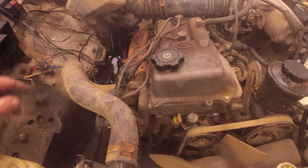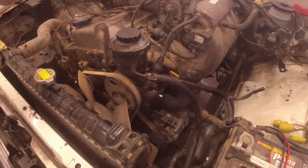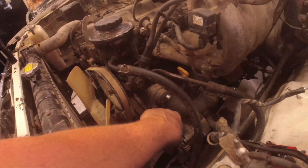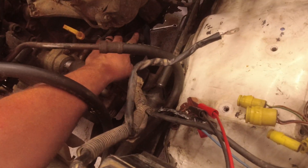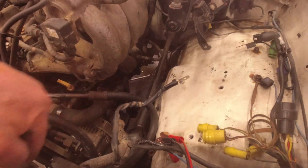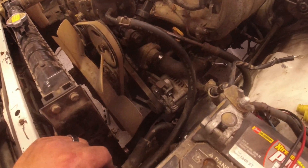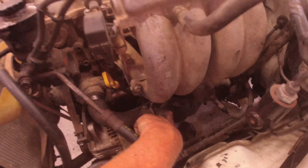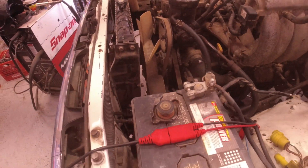This is the upper radiator hose out of the Tacoma and it just goes right where it's supposed to with no modification whatsoever. On the other side, the lower radiator hose is the one off the 22R - that's the elbow hose with the metal tube that goes around behind the alternator and comes out down there. All those hoses off the '85 or the 22R fit perfectly. I put a cap here because I ran the hose over to the heater, so I don't need that port anymore.